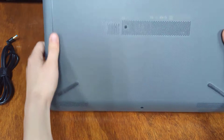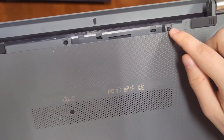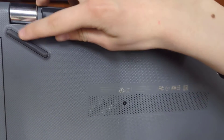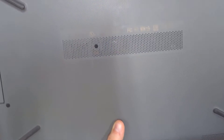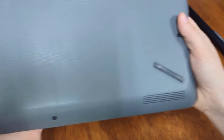There's a couple of hidden screws on this underneath these little rubber pieces, as well as two on the top underneath the battery that you'll need to take out. These are the rubber pieces that have the hidden screws. I'm going to use a plastic pry tool to pull this up to make it easier. This one's the DVD drive screw, and then there's a couple other ones that we'll have to take care of as well.